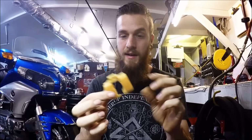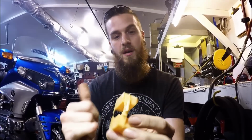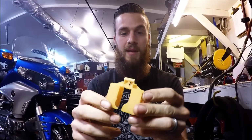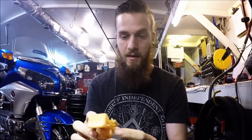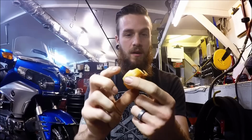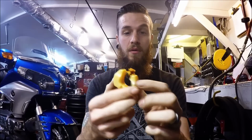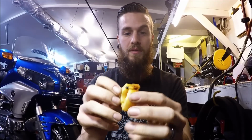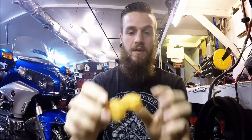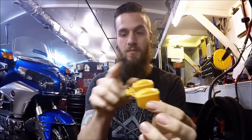It's a plastic style. This is actually a non-adjustable, and you will know that because everything is plastic. You can't really bend plastic. You can if you heated it up, but I wouldn't do that. You may see ones like these. These are more common in generators, lawnmowers, smaller motor style stuff. A little O with a non-adjustable float. Another non-adjustable here, plastic with a rounded edge.